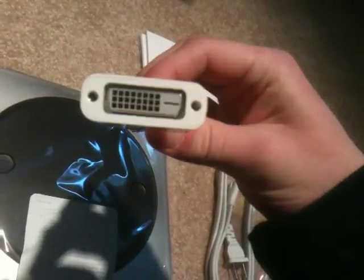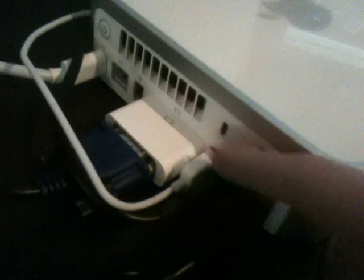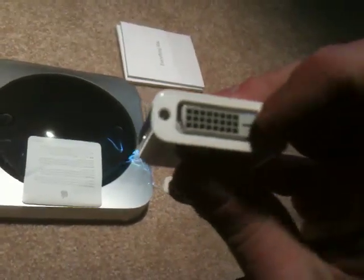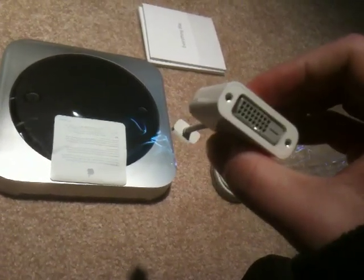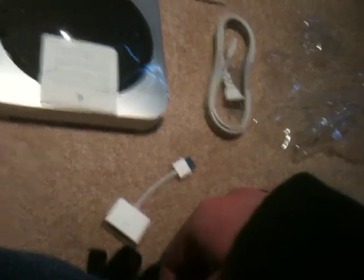There's a DisplayPort to DVI adapter, which is a problem because this monitor has a VGA cord on it. This monitor is not DVI, so that's a problem. On the old Mac Mini, I liked how they used DVI so you could just use a converter to get to VGA. On the newer Macs, they give you a DVI from DisplayPort — this is actually HDMI to DVI — and you can't put a converter on it because the relevant pins are missing. So I actually have to go out and buy another converter. Apple, always include VGA and DVI. People still use VGA monitors. That monitor is brand new. They don't include enough anymore.